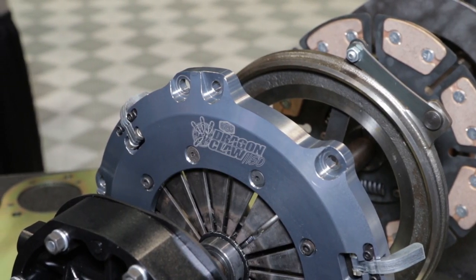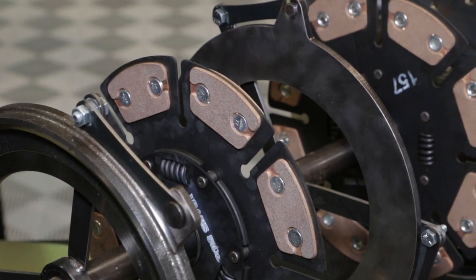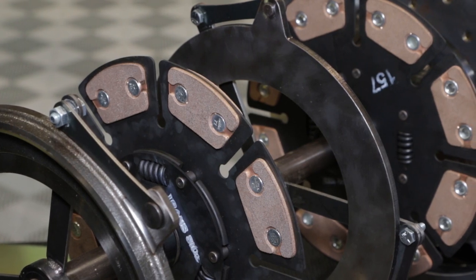A really high-performance clutch — I'm thinking this is like leg day at the gym, right? It blends two types of clutch designs together. You've got your Pro Stock clutches that have these little clamping rings that swing out with centrifugal motion, and then you've also got a diaphragm from a street clutch blended into one system. So you've still got that easy modulation for street driving, and then once you really let the clutch engage, it swings those little arms out and really clamps on to harness a lot of torque.